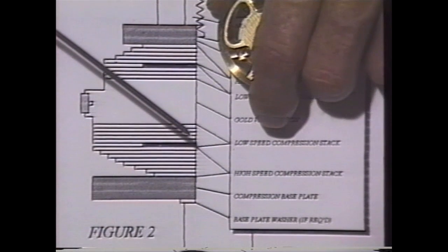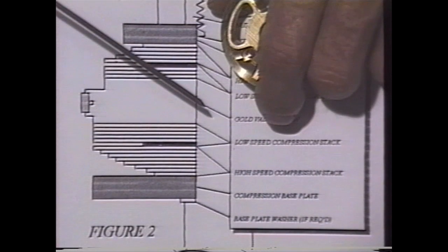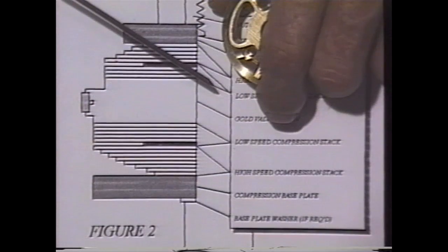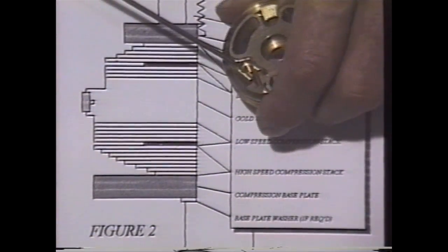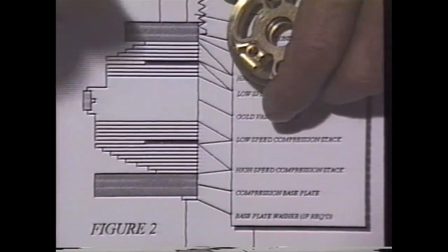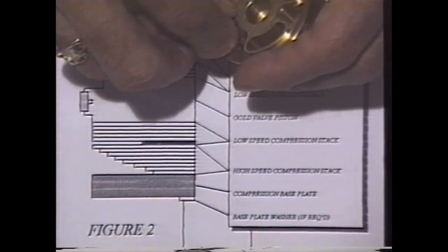There are a few different models — most notably 91 Hondas, CRs, and 89 YZs in particular — that actually hold a plug. They have a plug on the end of the shaft that you've got to be careful on. Some models are actually going to have a bleed, and what we've done is provided a jet. This little jet screws into the gold valve, and it comes blank. What you need to do is drill it out to a particular size that you need it to be, depending on the chart.